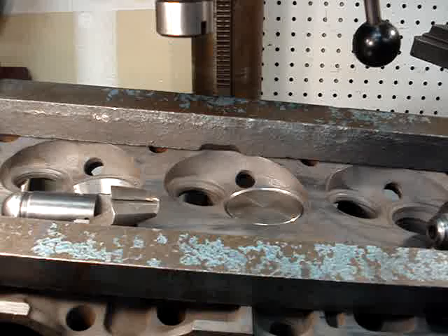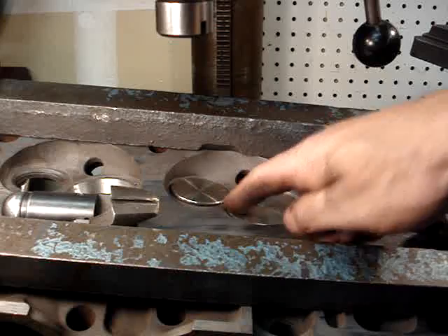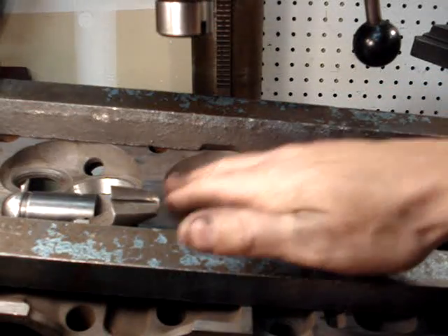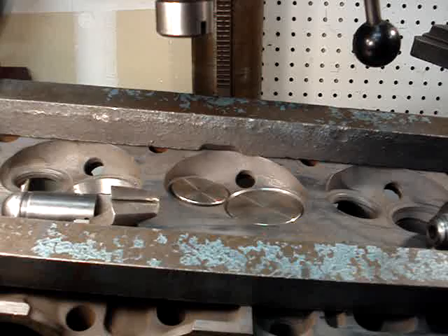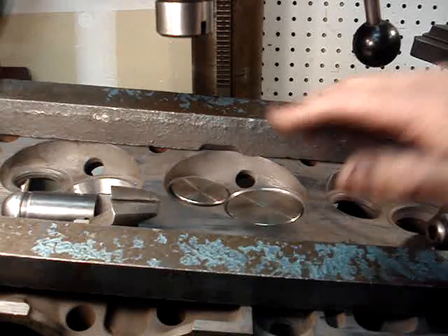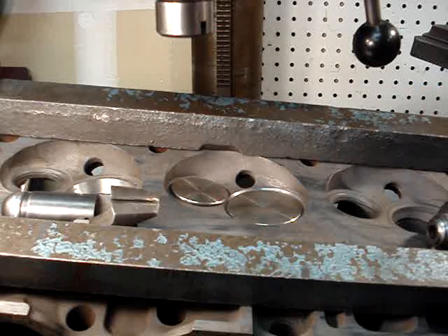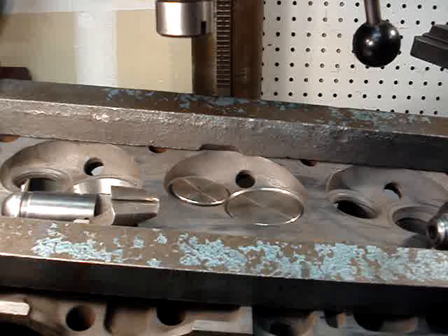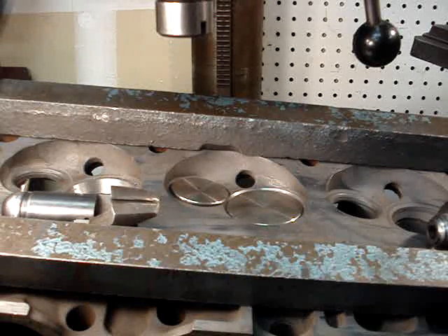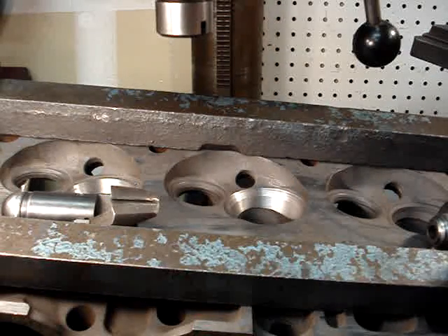And then of course, the exhaust seat is going to have to be cut as well. You can see that we still have the original seat, so this valve is sitting up way too high. Once we're done, they're both going to have their angles and be recessed in. And we're going to have a really nice set of street rod heads on a 500 plus cubic inch street rod motor. This is not going to be a super high compression engine — it's probably going to be about 10 to 1 because he wants to run pump gas with it and drive it on the street. So that's how you do it — we're upgrading these heads for bigger valves to make them flow. Gives you a little insight on the valve job there.